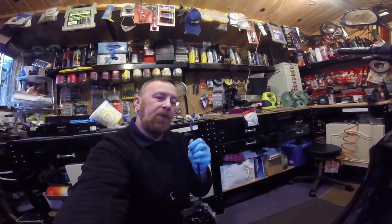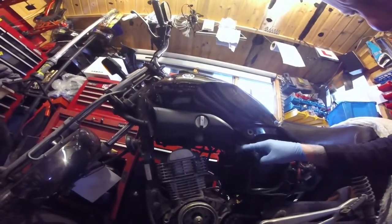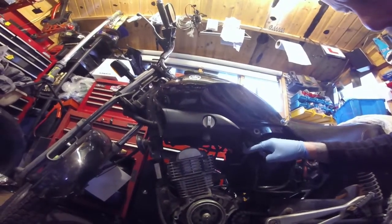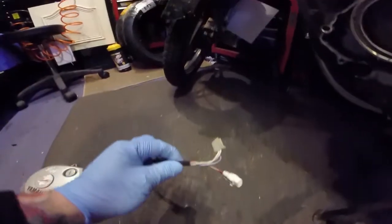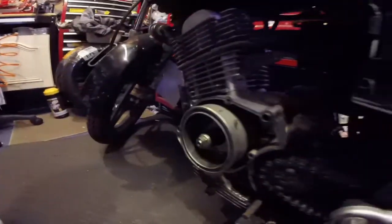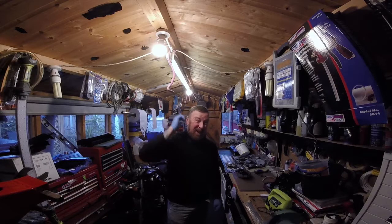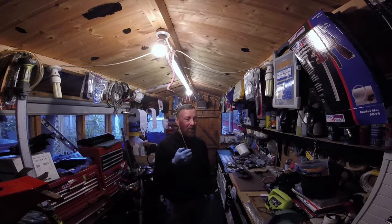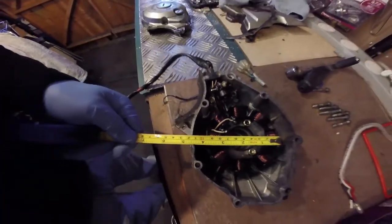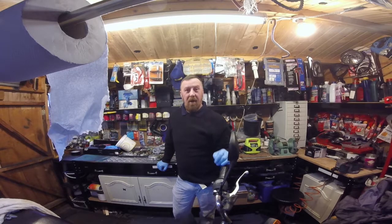The wiring — there's a two-plug and a three-plug on the bike, but his wires have been cut. One blue, two white on here; one blue, two white on the stator, so I thought it's just a case of marrying them up. But it still wouldn't go on. A little bit of head-scratching — tape measure time. The inside was about 90mm, and my stator was 95mm.